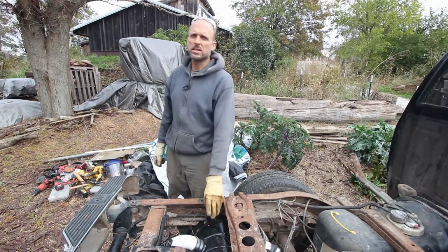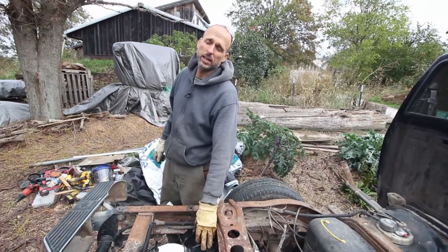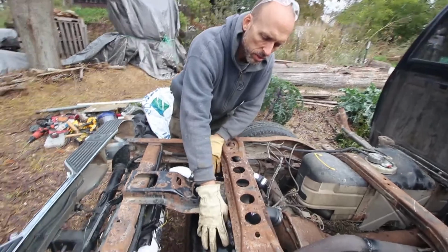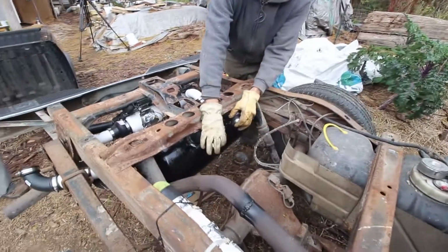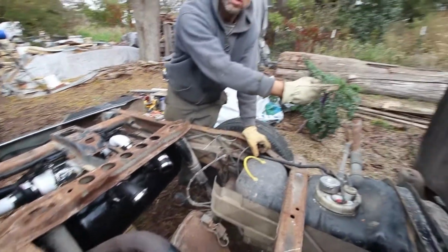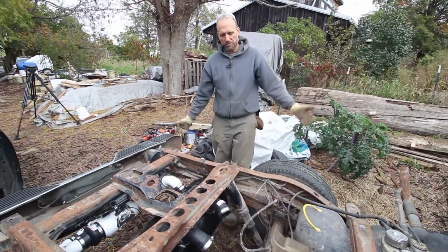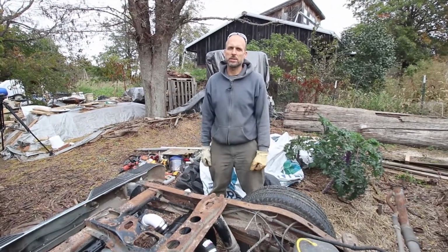And we have two different valves on this thing that allow us to bleed off both water and tar. It's a metal tank, meaning also that we can heat it up if it doesn't flow, or if it's a colder day and we want to empty out those two items. So this tank collects the moisture, the tar and the water, and then the cooled, water-free gas, basically wood gas, comes out of these and gets plumbed up to the engine. This is something else that we'll have to do, unfortunately, with the truck bed back in place. But effectively, we've done all we can with the truck bed off. Now we just got to put it on and crawl around and finish the rest of it.